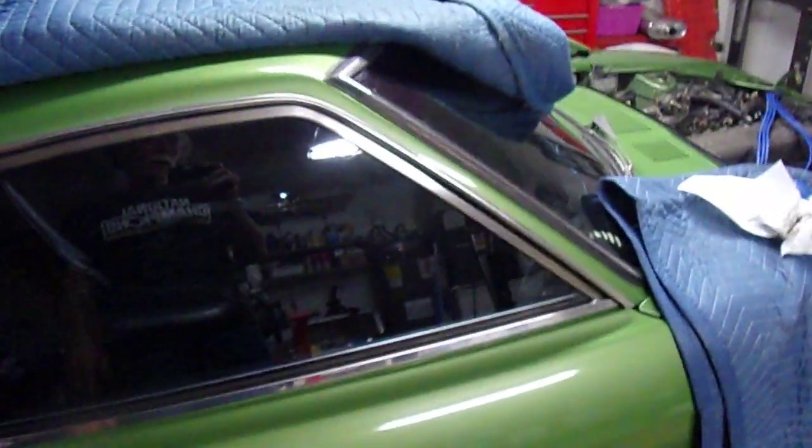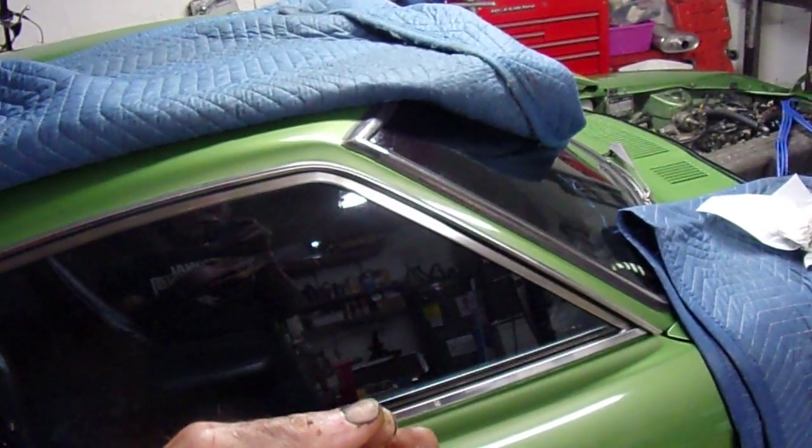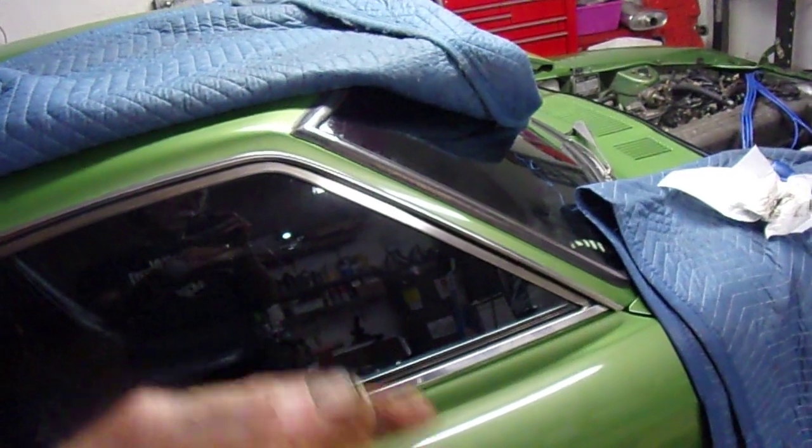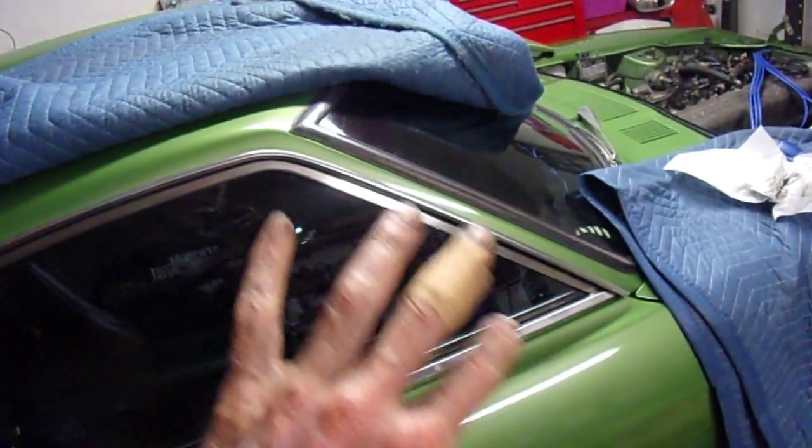I did not pull out the center console. You don't have to do that. For those of you who are doing transmission drops, you can literally pull the Jesus clip off the bottom of the transmission where the pivot pin is, knock out the pivot pin, and then leave the entire shifter assembly and console intact. There's no reason to remove that shifter and that whole console. It just comes up and it's out of the way for removing the transmission. So that's just a little tip.